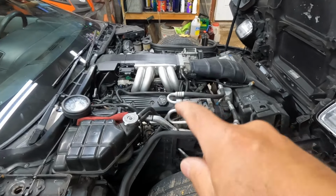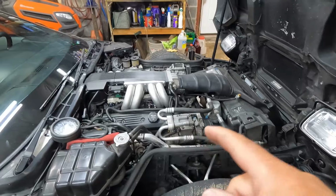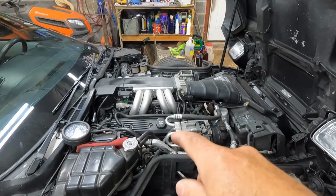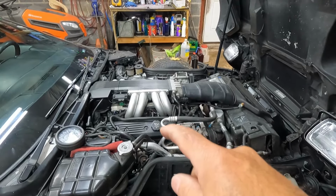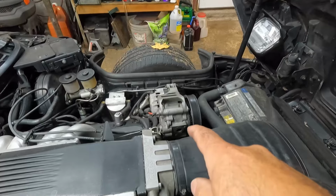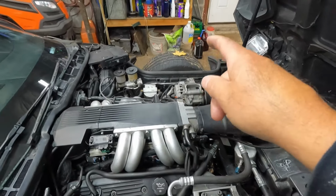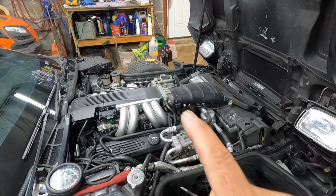But don't worry about it. This applies to basically stock motors. You won't have to worry about any of that. But they do that mostly because it reduces windage inside the crankcase at high RPMs. That's why race engines use a vacuum pump on the crankcase. Those are specially built. They're not like the smog pump here, which is actually designed to blow air into the exhaust. I actually have one of those that I converted to a vacuum pump and ran on the crankcase. I'll leave a link to all that, like I said, up here at the end of the video.